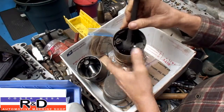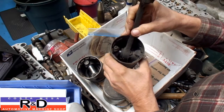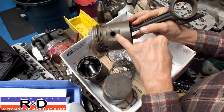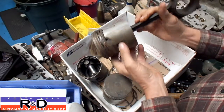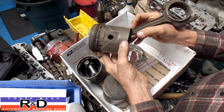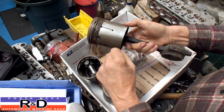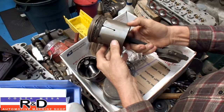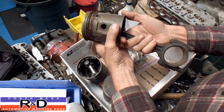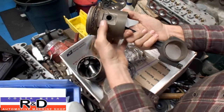The pin retention, of course, is done with a screw. We don't do that anymore because these were fairly low-revving engines — they could get away with it. The piston pin itself is rather unique; it has a hole going through where the screw screws right into the pin on this side. On this side, there's a slot cut into the piston pin for expansion. This slot right here was also meant for expansion, because they ran the clearances a lot tighter. They didn't have quite as much cam, meaning this side of the piston is ground less than the sides — you can see that by the wear pattern, where only about this much of the piston actually rides on the cylinder wall.